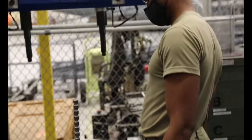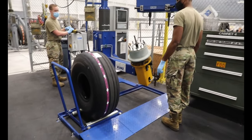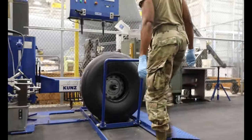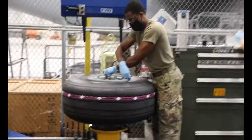We then put the inboard half onto the tire. After the tire has been lifted up with the inboard half, we put the outboard half on and begin putting washers and nuts on. You've got two nose tires — anytime one is bad, you change both of them.